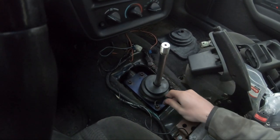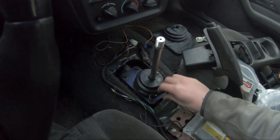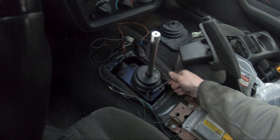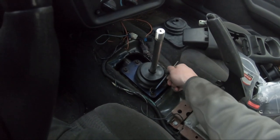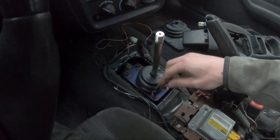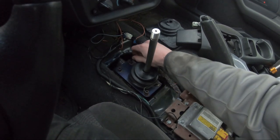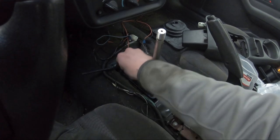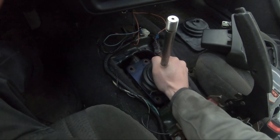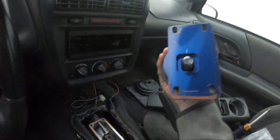So we're going to try to get this with one hand, I don't know how hard this is going to be. I also mentioned that that is the airbag sensor right there, so I probably should have unhooked my battery before doing this, but I didn't. So if I get hit in the face with an airbag, just know that we need content during this beer virus that's going on. This would be a whole lot easier if I had Allen sockets, and also a lot easier if I had two hands, but I'm going to do what you do for the vlog. I got the four bolts out and you can see they had a little RTV seal too.